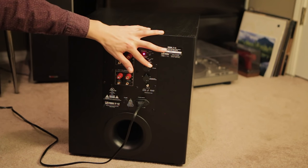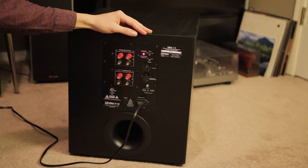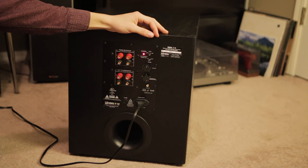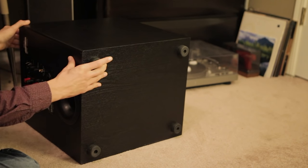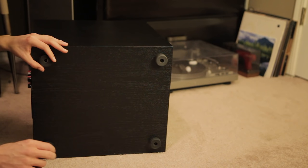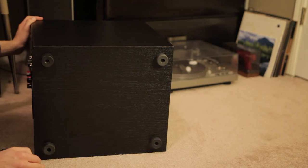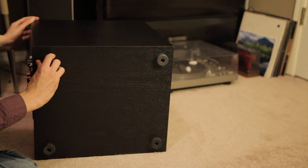The volume knob turns very smoothly and increases volume smoothly. The jumps between levels like five to six or six to seven are pretty big, so watch out for that. I usually have mine on six with phase set to zero. There's an auto power feature, but like most auto features it's a little finicky — it actually works pretty well, but I prefer to leave mine on just in case. This subwoofer is about 25 to 30 pounds. On the bottom there are rubber feet which are fairly cushy. It'll do a decent job isolating on a wood floor, but you can also get isopads, which decouple vibration from the floor. You can also unscrew the feet if you like.